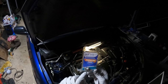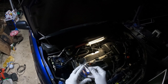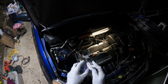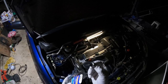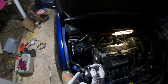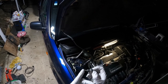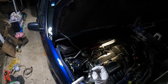All it does is thread into the block, and you've got a little sensor part on the back side of it that just clips in. Now this is a 24mm deep socket job. The reason you need a deep socket is to get past this little sensor part — a normal socket won't go past it and you'll end up damaging that sensor on the back side.